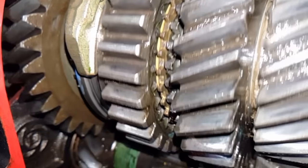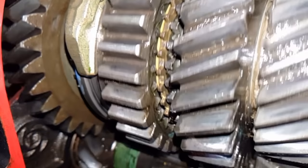With further force on the selector fork and with the speeds synchronised, the outer sleeve is guided over the baulk ring and onto the main gear dog teeth, locking it all up as one unit. And there we go. Thanks for watching.